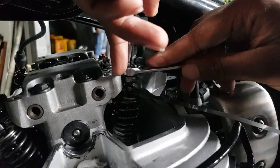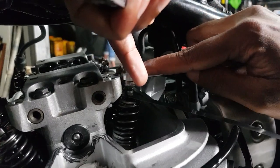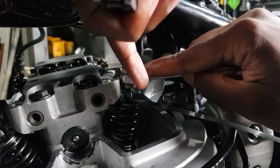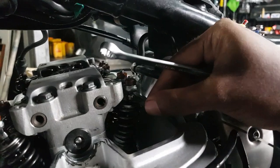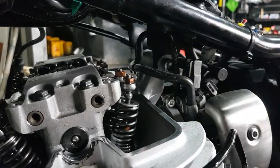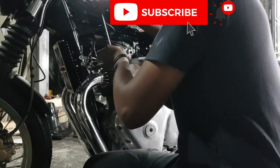If it gets caught as you pull it along, then it's too tight. Just take your time with it — it should feel like it's dragging in and out. When you feel you have it just right, tighten the nut and you're done. Adjusting the valves is fairly simple: just loosen that copper-colored nut and then tighten or loosen the little adjustment screw using a flat head.